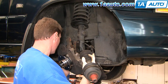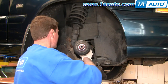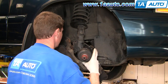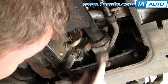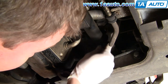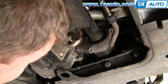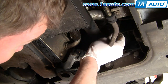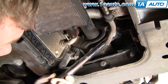Be careful of your brake lines and your CV boots. Now your cap goes back on. There's a larger space here — that goes to the bottom. Torque these to 35 foot-pounds.